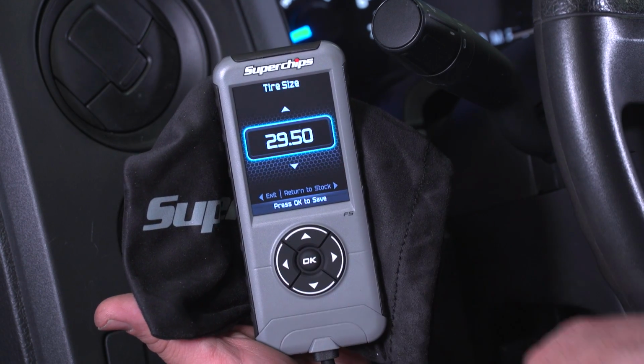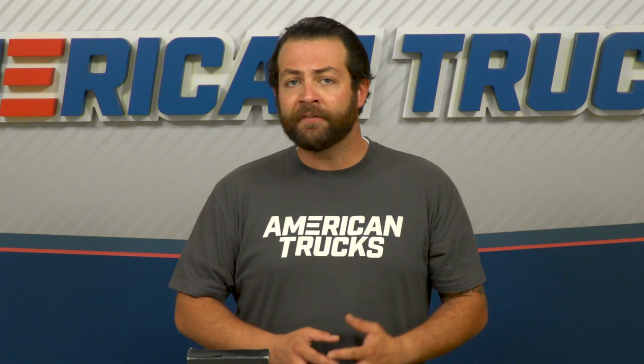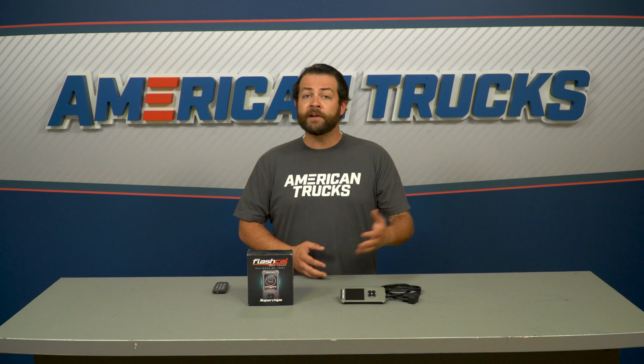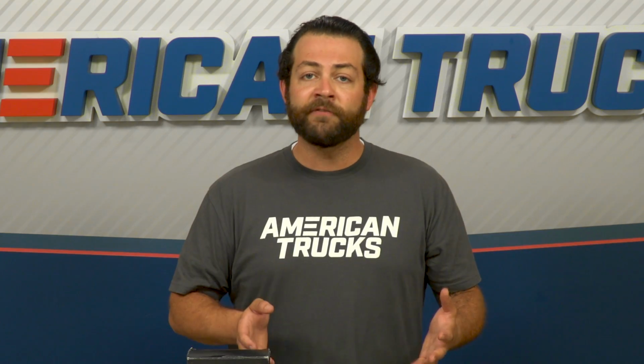Now, you can monitor everything from engine temp to intake manifold pressure to air intake temps and plenty more. You can even modify your speed and rev limiter, idle up, and read and clear trouble codes. But what's really nice about this is if you do go down the tuning road, you have all the information you need to calibrate your truck in one device.